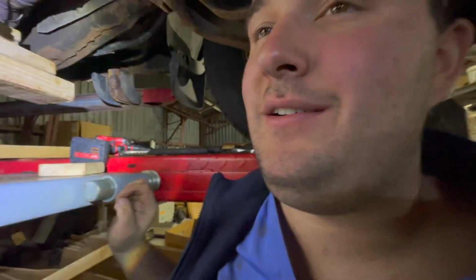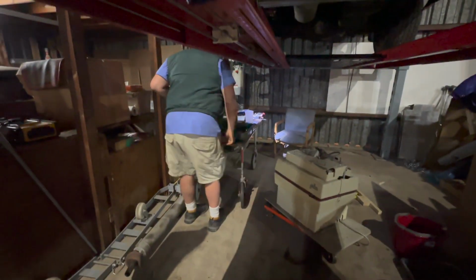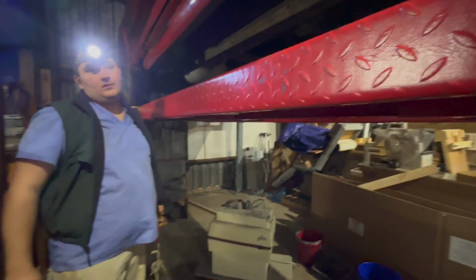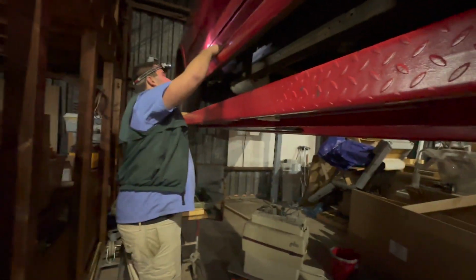Never mind, it's okay. Is it back on? Yeah. Sorry, guys. Tyler stopped the video. And in case you guys buy a used transmission, just beware. Make sure to check that those guide pins are out of the old transmission case, or else it'll be a problem. If you look in the time lapse, that's what we dealt with, and then we realized what was happening.